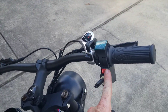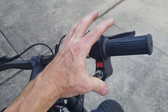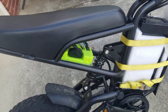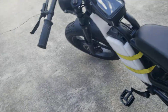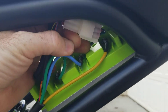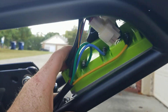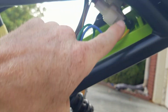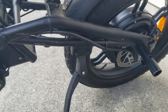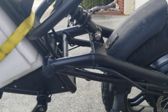Links in description — I got this assembly with the switch, the lock, the volt meter, and the twist throttle, it's all one assembly. The seller was great to work with because he provided the hall sensor connector that I needed — the connector type he was nice enough to provide. Huge shout out to him for the mating connector, because the Loon Yee motor came with some generic default China-spec connector and the Fardriver came with a nice waterproof connector, so I wanted to match up with that.